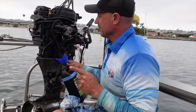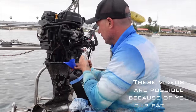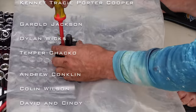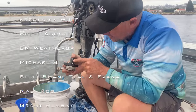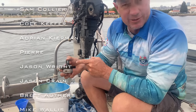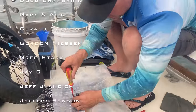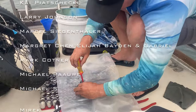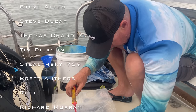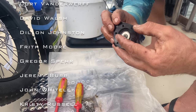I've got a feeling this may have been leaking fuel. When the diaphragm fails it could leak fuel into the oil — and I'm gathering that's why the oil is so thinned out. That looks like rubbish. I can see fuel getting pushed out here, which means it's going straight into the oil and thinning it. So I've half opened this up to see what the diaphragm looks like. I had a suspicion this wasn't working right — which means fuel was going into the oil reserve. There's a hole in the diaphragm and a hole in the pump.